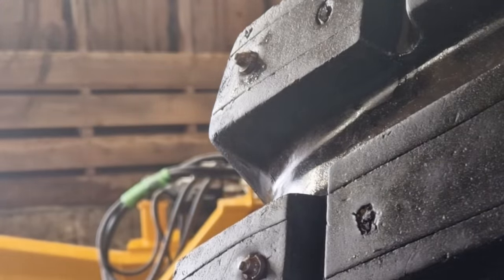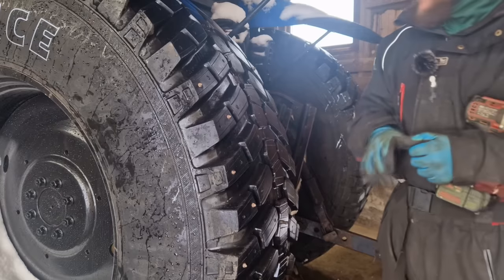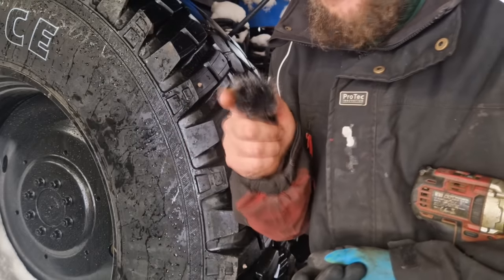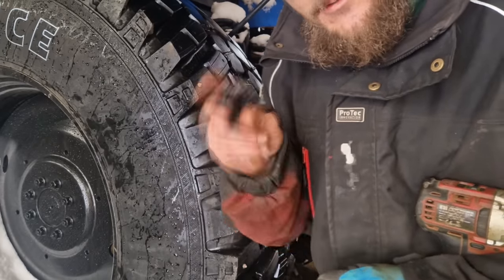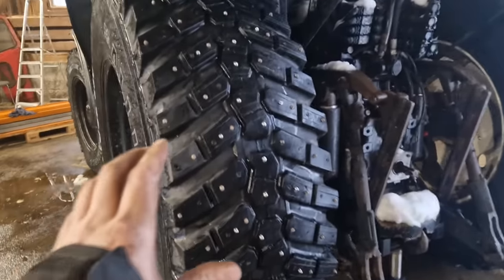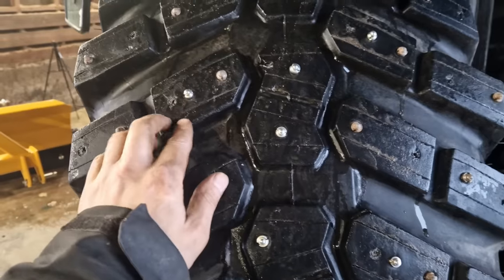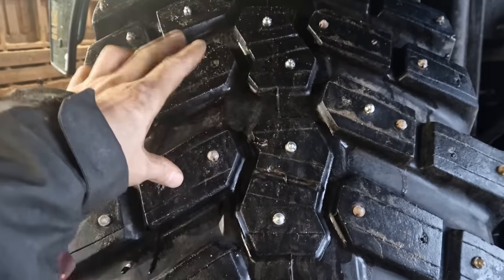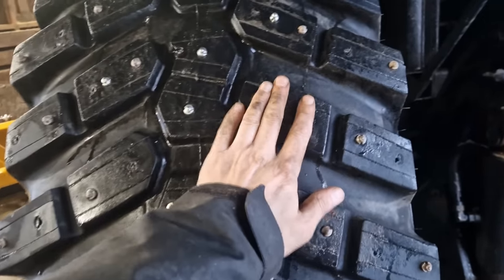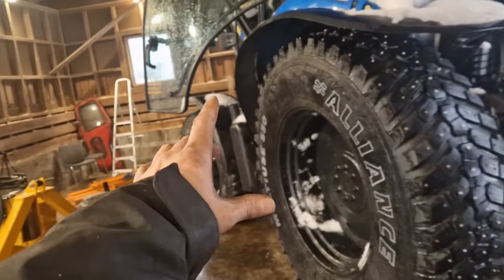I need to gear this down, it's a bit fast. I'm going to take off my microphone — they're quite expensive so we just have to deal with the onboard sound from now on; I'll do some EQ and try to make it nice. Alright, that's one tire done. I put additional studs in the middle this year, and also an additional stud in every other knob on each side. The shiny ones are new this year; the others I had in the opposite pattern last year.